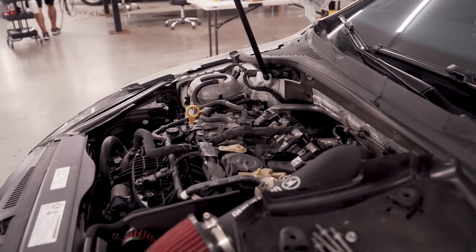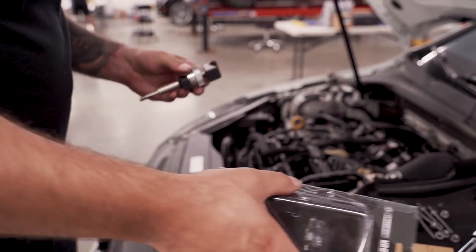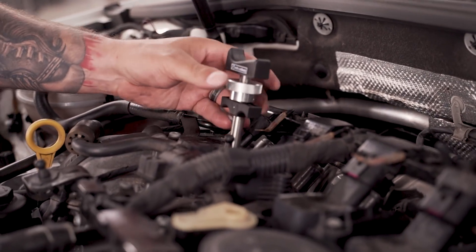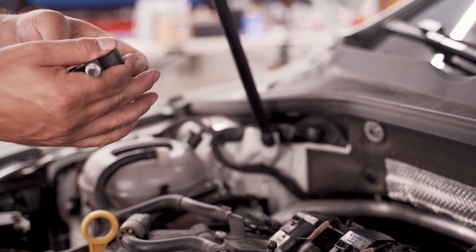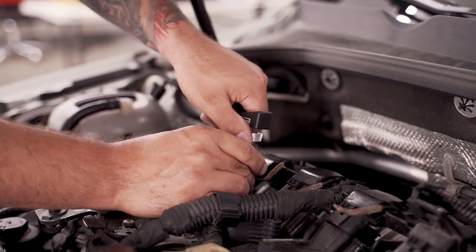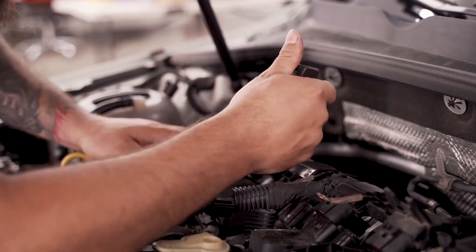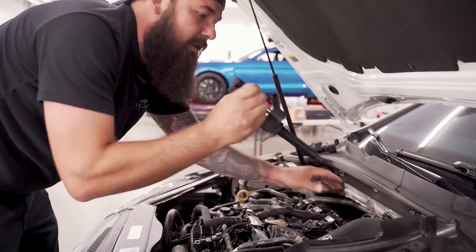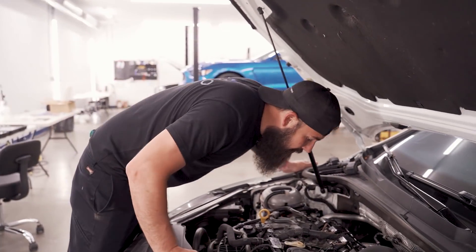Back to the coils. We've got a coil puller tool — I'll put a link in the description below. You need this to pull out the coils. This goes into the hole where you took that long bolt out, then you tighten it down and it opens up, and you can pull the coil right out — pops right out. I'm lining up the coils on the cowling here in order so when I go to put them back in, I can put them back in the exact hole they came out of.